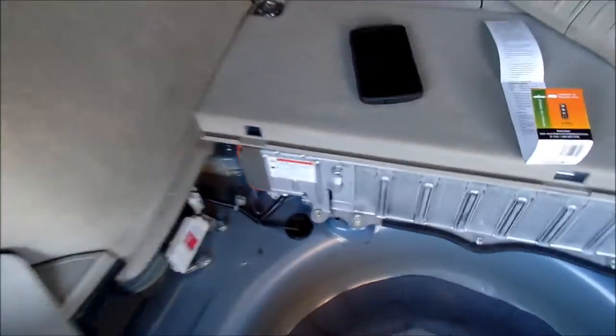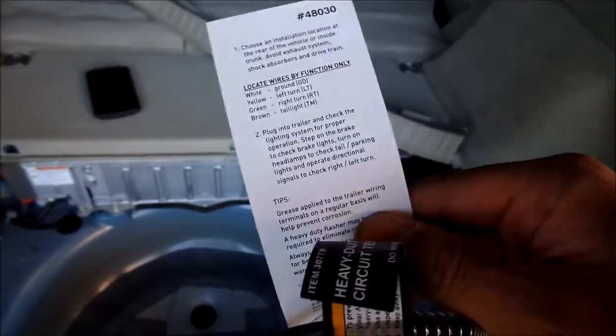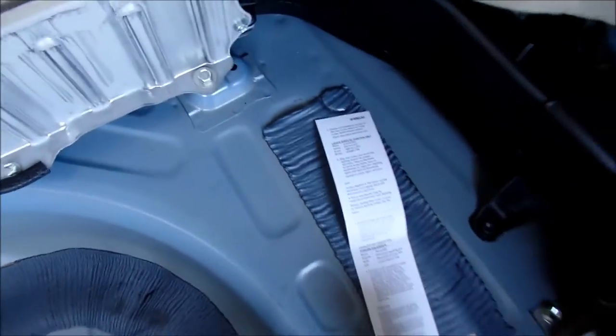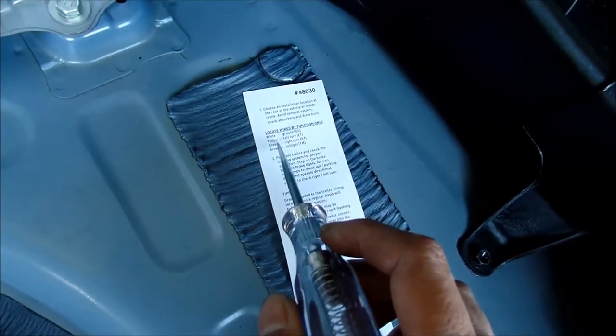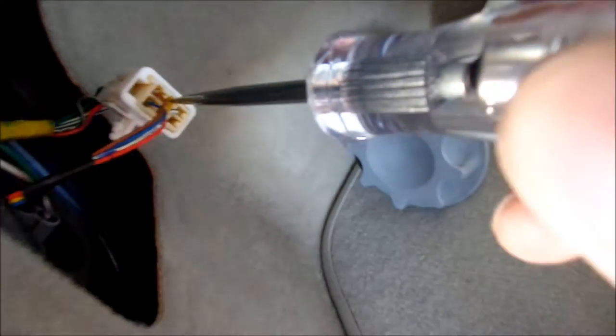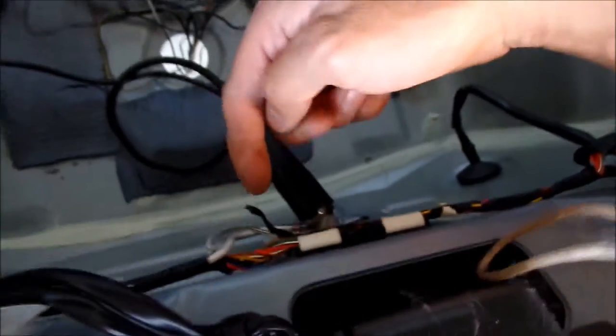I should have put two into the other. All the wiring here is the same as the wiring on the car — Toyota used the standard trailer wiring convention. The yellow wire is the left turn signal, and sure enough when I check the yellow wire on the car it blinks. So I'm looking for a yellow wire in the harness — looks like there's only one, so that's probably it. And I'm assuming the green wire is the right turn signal.